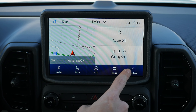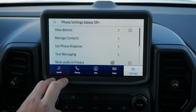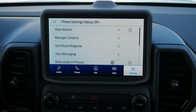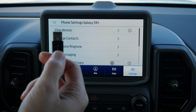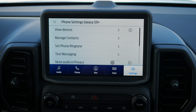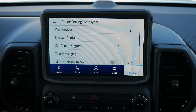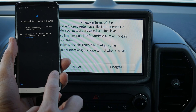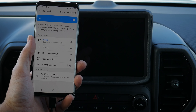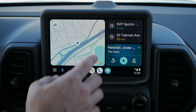Once the Galaxy is connected, go home and you can see it there. Click through Phone for additional options. Similar to iPhone, Android is a wired connection for Android Auto — make sure the USB cable has data support. Plug in and follow the on-screen prompts: Continue, agree on the phone, and within a few seconds you're fully connected.